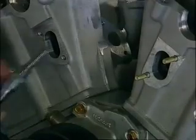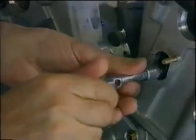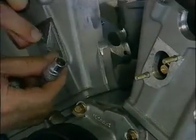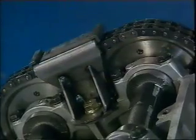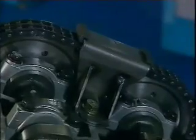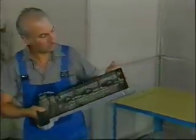At this point, refit the two chain guide bolts at the front of the cylinder heads, and also the two small covers. The top chain guides can be bolted into position. When you come to fit the cam covers, run a final check on those integral gaskets, just to make absolutely sure there's no damage.